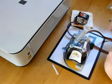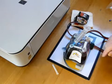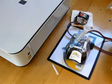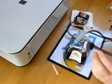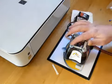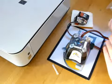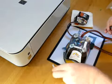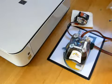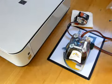So what's actually happened is you've created a vacuum inside. Basically you'll hear some gurgling, and you'll see the ink shooting down the line, and you'll see that the air's been removed and it will be full all the way to the cartridge. So you'll repeat that process for all of the other colours that have got more than about 4 to 6 inches of air in the line, and that's how you prime the system if you've got that.